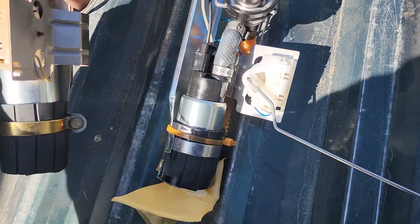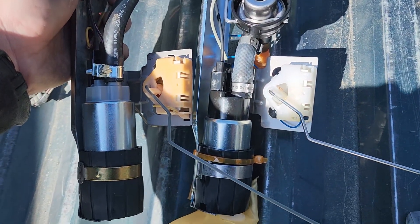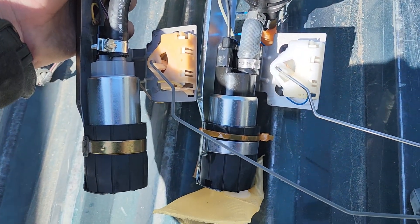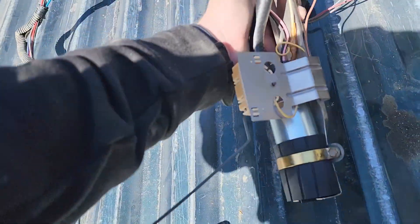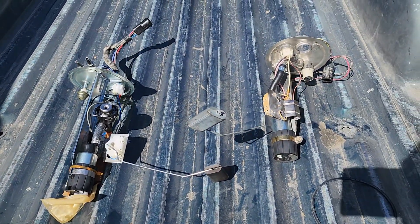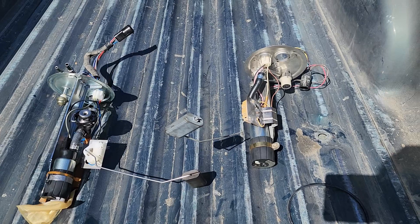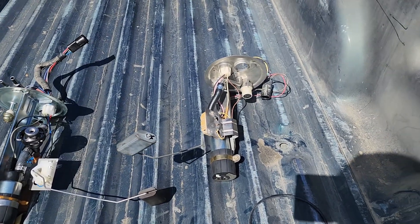So I was able to find the right line and I took the regulator out when I upgraded to the Walbro pump. Here's the factory Ford pump, here's the Walbro 255 — I'll show a bit of a size comparison. The main body of the pump is almost — I'd say that's a good half inch taller, the whole pump is larger. So that should solve my fuel delivery issues to the engine and stop my surging, and give me a more stable fuel system to properly tune with.